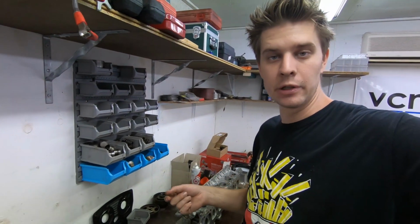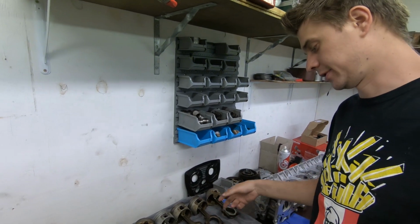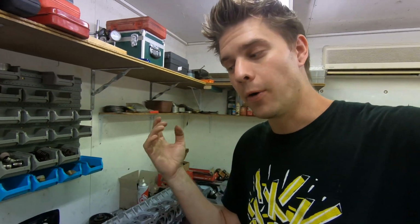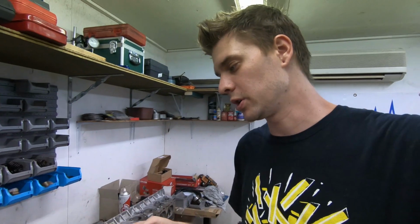Sorry guys, just thought I would throw in as well. You would have seen the other day when we did all the mains and Zach was here, I actually have already gone down and torqued all the rod caps. This is very important when doing your measurements because having your rod caps actually torqued will change the measurements. It does change the roundness and everything of the rod, so all of your bearing clearances need to be done with everything torqued to spec or almost to spec.